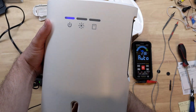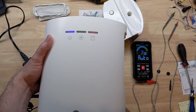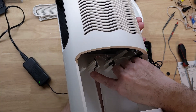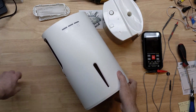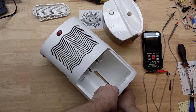So if we hit the bucket-full switch, we see that it does show the bucket's full. But when we release it and hold down the in-place switch, it's not coming on. At first you might think that's the in-place switch, but it's not — it's normally closed on the bucket-full switch. This will be more clear later. Let's continue with the disassembly.